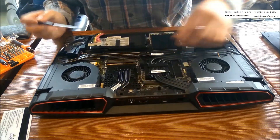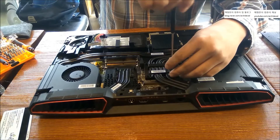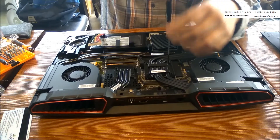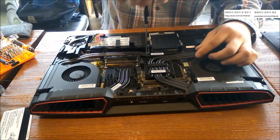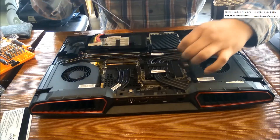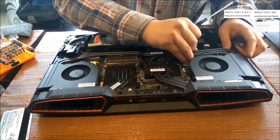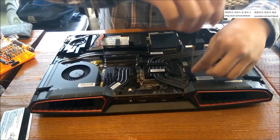Simply use the screws of the heat sink — both of them, easy, no worries. When I use thermal paste, I always use Liquid Ultra, but if you want something different, have a look at Thermal Grizzly Kryonaut or MX-4. All three will be linked in the description. Before you take off the heat sink, the cooler is blocking the way, so you should take off the two coolers too.